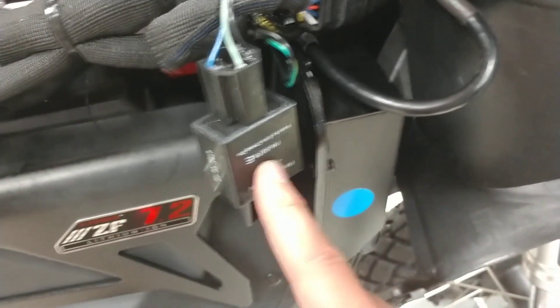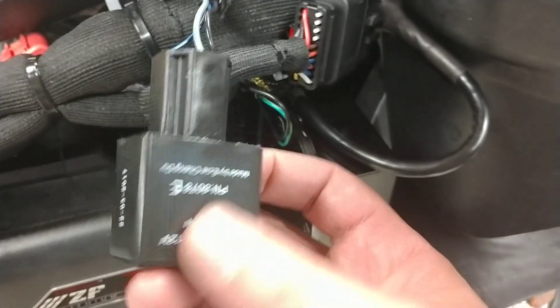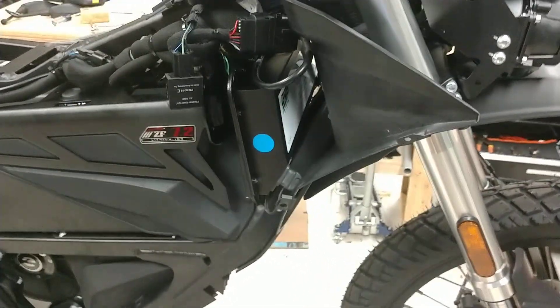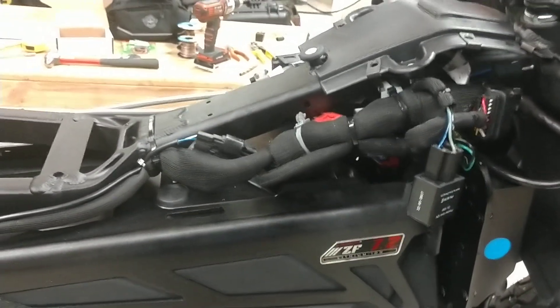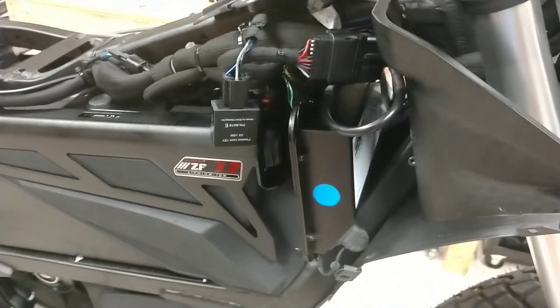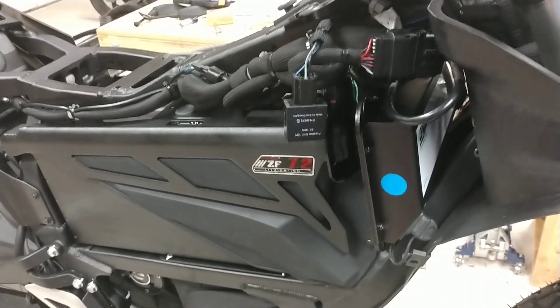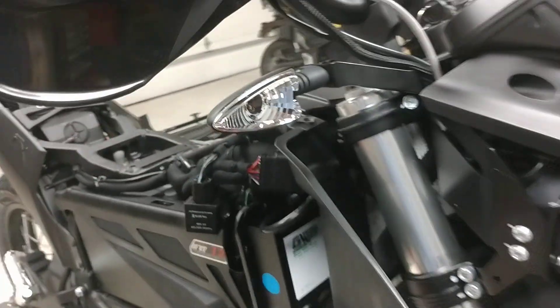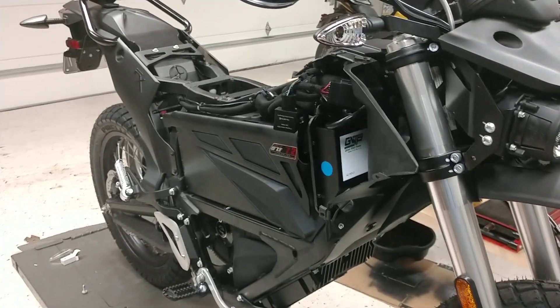I got an electronic flasher for the LED lights, but I'm not having much luck. The pinout on this flasher is backwards of what's in the unofficial manual for the previous years — which actually makes it normal, because the previous years had a strange pinout that was hard to find, so this actually makes it easier. But I already bought the other flasher so I need to get a new one. Also my LED bulb is too big to fit in the housing — it fits in there but the cover doesn't go back on. So I'm not having much luck with the LED side of things, but I will get the correct flasher and the correct bulb.